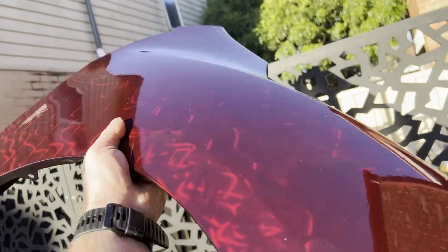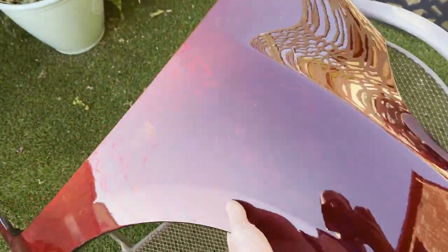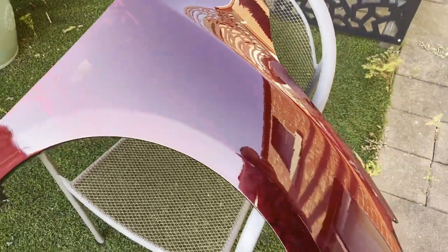So in a nutshell, he gets a steel ruler and a paint scriber, or a steel scribe, and scratches lines in the panel, then lays the tape down on it. He presses on the tape really firmly, then rips it off really fast. Look, I don't know all the ins and outs about the adhesion tests. I just watched him do it. I did film it on my phone, but that was 6 months ago and I've lost the footage. So he scratches up the panel, makes all these little squares with vertical and horizontal lines, applies the tape on top, then rips it off. I think out of 100 squares, if up to 5 squares pull off, it still passes the adhesion test. Well, on this panel, no squares came off. It had perfect 100% adhesion, and I was quite surprised.